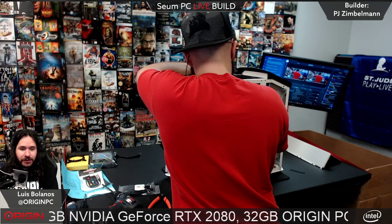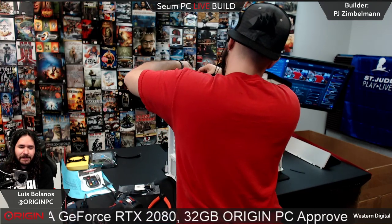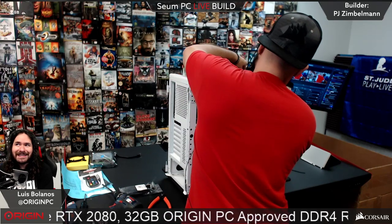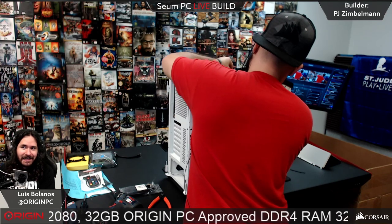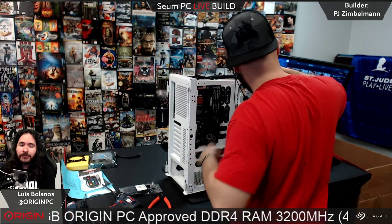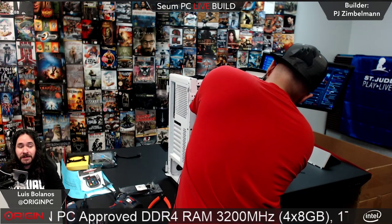What is your recommendation for a streaming PC on a two PC system? So it's changed over the years. A couple years ago, I would say your CPU is very key. But now you can use NVENC encoding for your streaming PC. So if you get a pretty decent GPU, like a 1660 Ti, and maybe an i7 or i5 or a Ryzen 5, Ryzen 7, that's good to go. I wouldn't recommend spending over $1,000 on a streaming PC unless you want to do more than just stream on it. What other people sometimes do is actually get a laptop